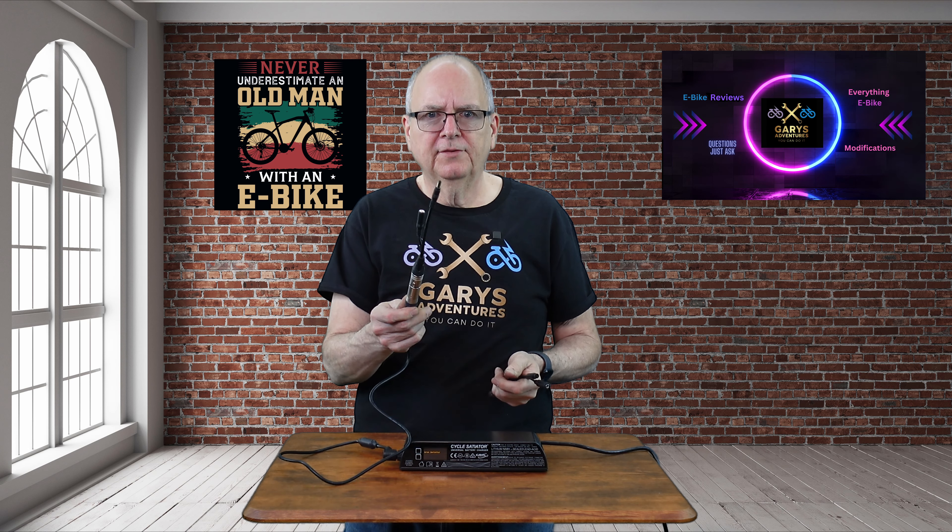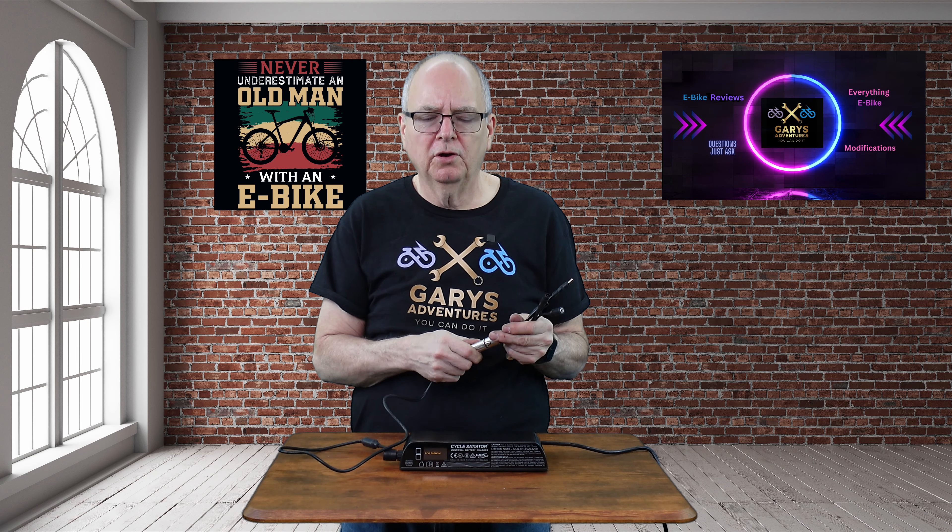This has got everything I need. You do have to buy these adapters — they're about $22 a piece. The plug that comes on here is a standard plug for a lot of my batteries. 52 volts or 48 volts, same exact thing, so I just plug directly into those. Electric bikes have this pin here, so all you do is plug this thing in like this, plug it into your battery, and you're good to go.